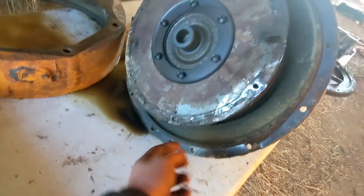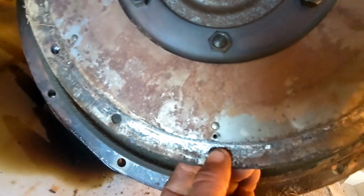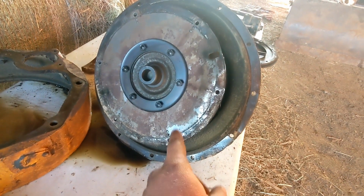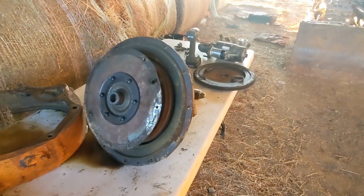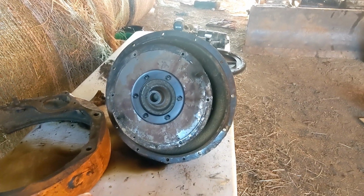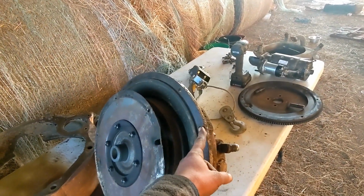I turned it, and there's a few extra holes. In fact, looks like there's more. See that? I got a broken bolt there. So yeah, there's actually 6. So that confused me. I got back to that one and thought that I was done. I thought that was the original one. There was one more. It was this one past. So whoops. If I had realized that, and I should have, because I have a manual that told me, if I had realized that flex plate was on there, I should have done all those bolts first and then taken the bolts out of the outside.